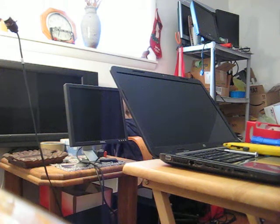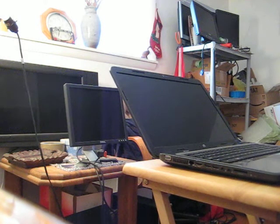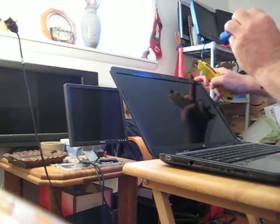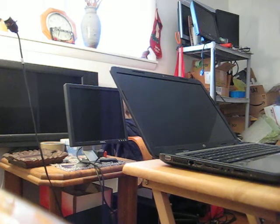This is a simple job on the G7 and it's not going to take a whole lot. The first thing we want to do is take the bezel off the lid, and this is where the knife comes in handy. There are no screw holes along the top or sides of the G7 bezel; however, there are screws at the bottom two corners.